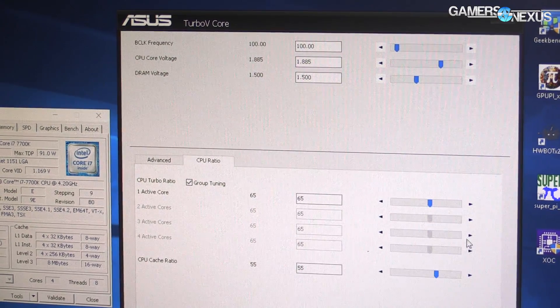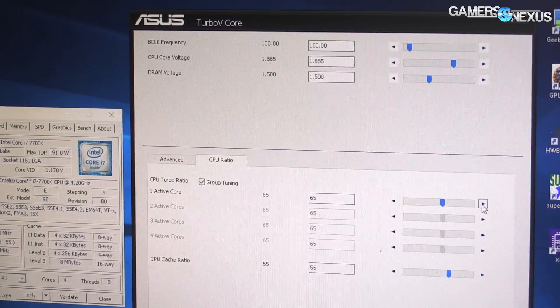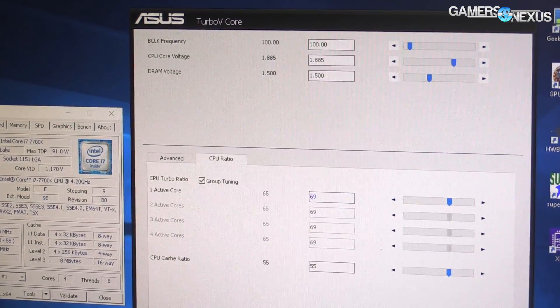It's really simple, and then once you're in Windows there are a few more voltages you have to set — like PLL termination voltage, which makes the CPU a little bit hotter. You need that to make a full pot. We also need to crank up vCore to like 1.85 or 1.9, then increase the core clock and cache clock, and that's pretty much it.